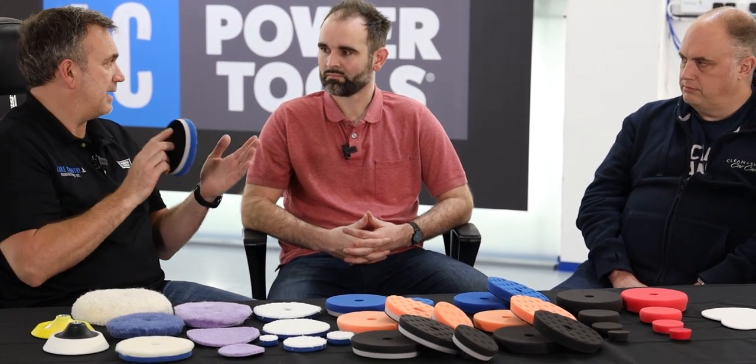However you put compound on there and run it across the pad, the paint, we had this discussion the other day, where do you spread it out, do you pat it? In the end, it all spreads out the same. You've now got pockets where the compound does not get absorbed into the face of the pad. So what you get is little dispensers that are gradually dispensing the compound. Some people might prefer that because you can pour the compound on and it gradually works its way. Now, the first pass, it doesn't. After two or three passes, we stopped and looked at it, and we created a test video recently, and you could see that literally it was left over in the pockets.